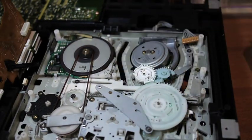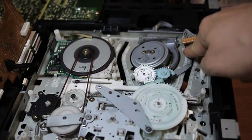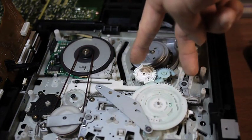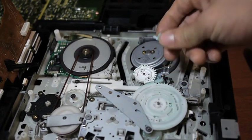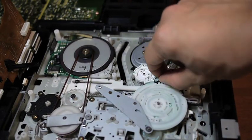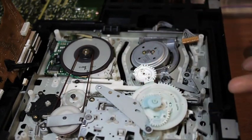This one works well, but this one doesn't move at all when I insert the tape. Initially I did not notice that, but then I realized that you are supposed to have two arms moving together to push the tape toward the video head drum. Now, this is a plastic gear — I just have to remove it. You can see that it's completely broken into two pieces.